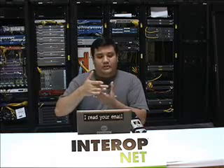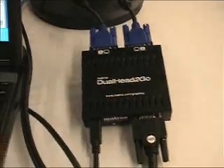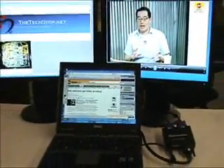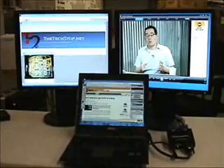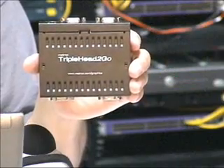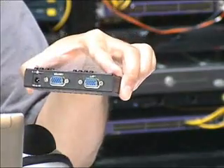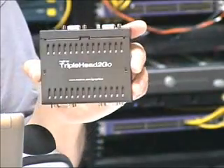But to the computer, it still looks like a single massive display. In practice, these are incredibly easy to use. The Dual Head to Go has one analog port on this side and two analog ports on this side, and it's powered by the USB connection from your computer. It can display up to 2,560 by 1,024 resolution at 16.7 million colors and 60 hertz, stretched across two 1,280 by 1,024 displays. The Triple Head to Go ups that — it also uses 1,280 by 1,024 displays, but since it uses three monitors, it can go up to 3,840 by 1,024, making for one massive widescreen monitor.